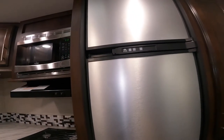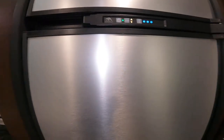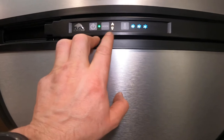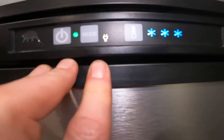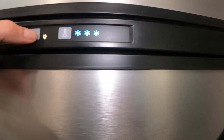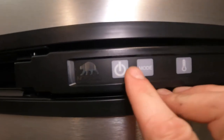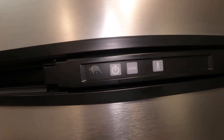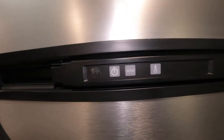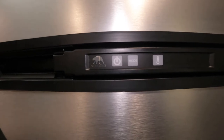We're going to continue towards your fridge and take a look. Your fridge operates on gas or electric — it has three modes: an auto mode which will select electric if available and go to gas if not, a straight electric-only mode, and a straight gas-only mode. If there is a problem with the gas and it's unable to light, you will see the lights here flash. When they do that, turn the power off, wait a minute or two, and come back and try to light again. Also go out front and make sure you have the valves open on your bottle — nine times out of ten it's either the valves aren't open, or you just opened them and there isn't enough pressure built up, so trying to light it a second time usually does the trick.